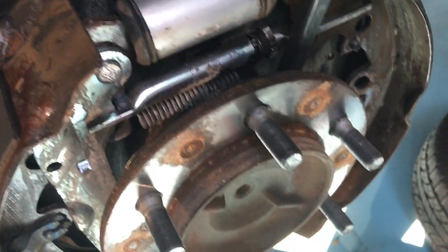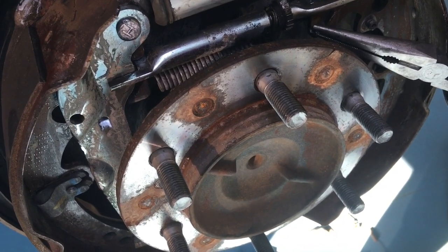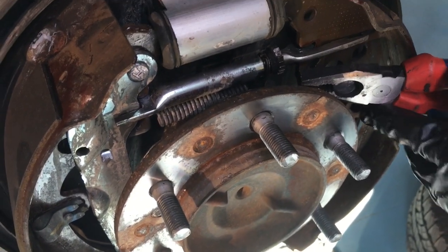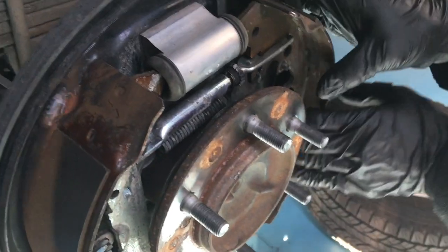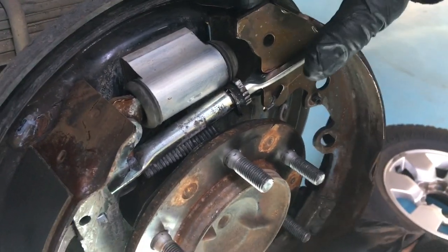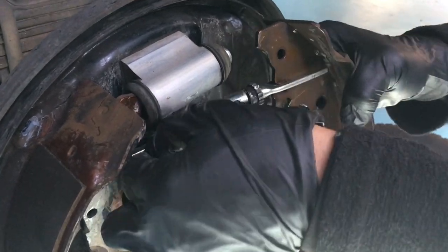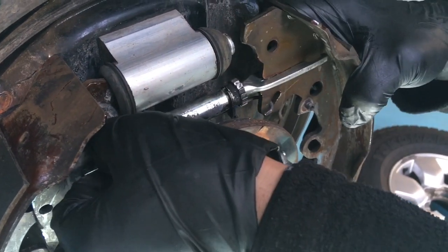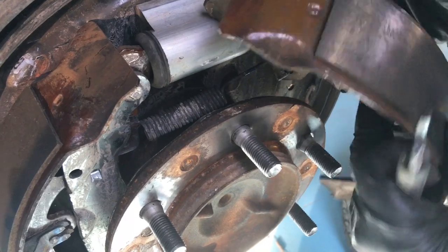It's very strong so you need someone pushing the shoe, or yourself if you can get a good grip and pull. The other way is: take the shoe off the top, lift the whole thing out the top, then allow the shoe to come in and the spring no longer has pressure on it. Remember how you got it off because it's often the best way to get it back on. Get the adjuster out — beautiful. That spring hooks off, so let's remember how it goes.